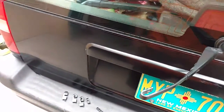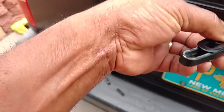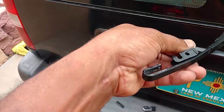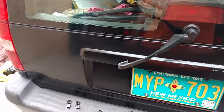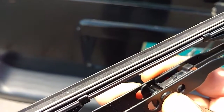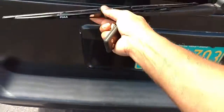Next, see which adapter that came with the wiper blade will fit your wiper arm. You can take them one by one and see if they fit before you select one and install it in your blade assembly. On mine it looks like this is the one, so I'll install that in the blade and then install the blade on the vehicle. This arm has the hole there and the adapter has a little latch inside, so it will clip in place. You hear it click and then it won't come out. Good to go.